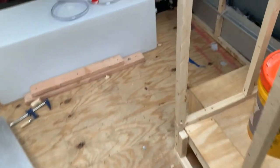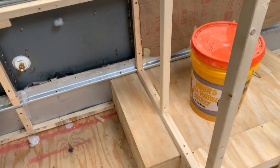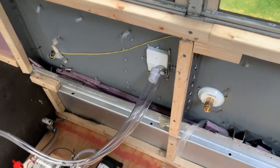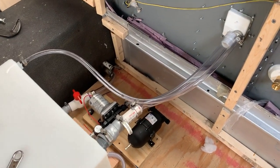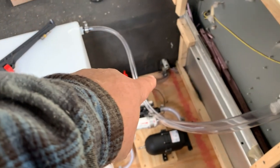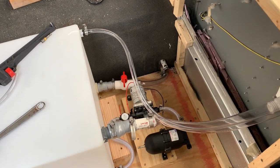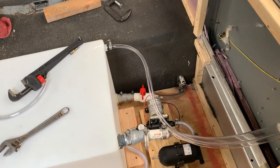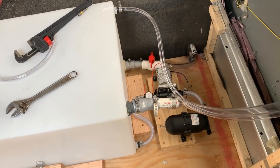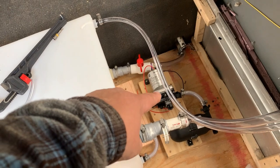Welcome to our bedroom where we're ready to start doing plumbing - we're going to be using PEX for the most part. The gravity fill is plumbed in to the fresh water tank, the air breather comes out and goes back out there. The drain goes out there - I used the heater outlet for the bus, a hole that already went to the outside. It's on the lowest point of the tank and the system, so that's plumbed in there. The valve is shut off and we have the outflow going out to our water pump.